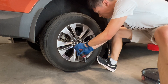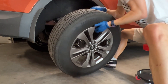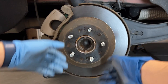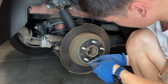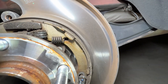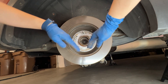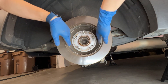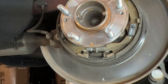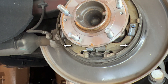If your parking brake works properly, the wheels will not spin while you're pulling out the lug nuts. Disengage the parking brake and make sure the rotor spins freely. Inside this drum there are a pair of brake shoes in an arc shape. If you pull the handbrake or push down the pedal brake, the brake shoe will push out against the rotor. If you drive the vehicle while the parking brake is engaged, the brake shoe will wear out and the gap will be more than the brake stroke. We can fix it by adjusting the brake shoe to get closer to the rotor.